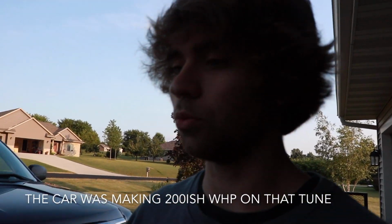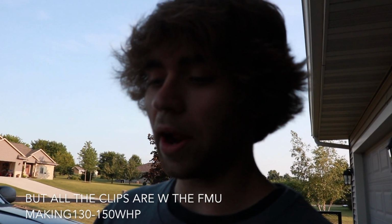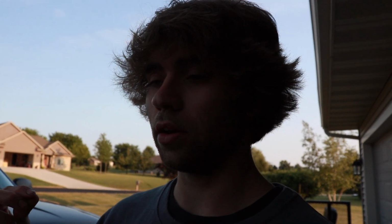So we ended up getting it all to work, and we went to put it on the dyno, but something was wrong with the dyno, and we ended up just doing a street tune, and we street tuned on 10 PSI. Ripped it around that night, and then the next day I realized I was filling up my coolant overflow, and I was getting high coolant temps and stuff.